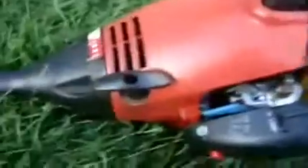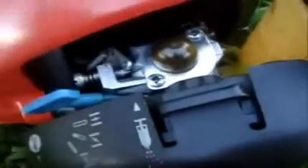I discovered the problem with my Z825SD. When I was putting on the carburetor, I noticed there's a big crack right over here and there's air coming in there. So as I'm priming it, gas is just not going into the carburetor. It will run as soon as you put gas directly into the carburetor, and then it'll run and die — just like Dave says. I'm going to see if I can get that broken part at my local repair shop and try to film it for you guys.